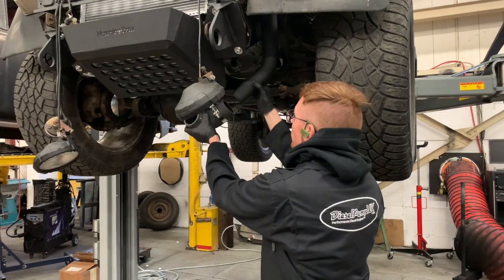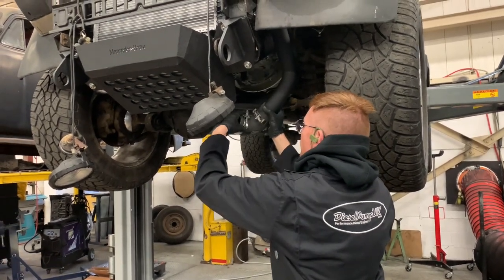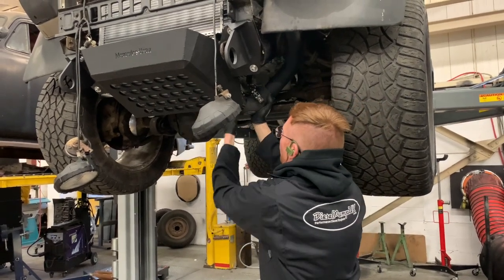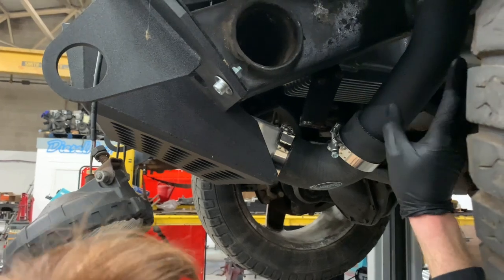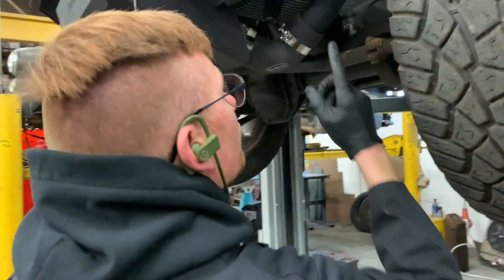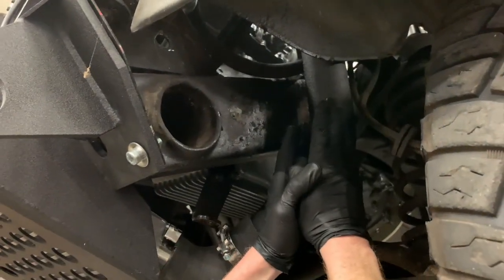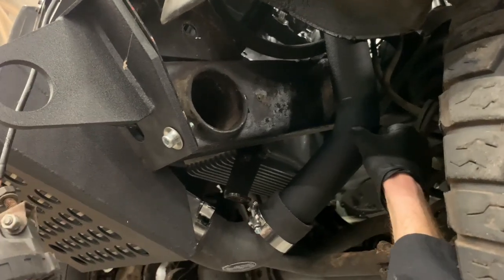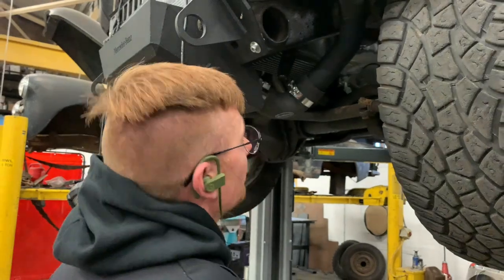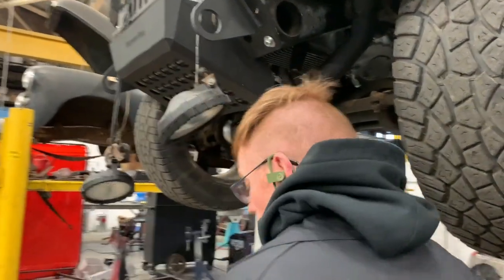And that just literally is as simple as pushing that onto there, and then if the clamp will allow me, push that onto there. We push that on there and that's it. What I normally do, if you are building a right-hand drive one, is this inner wing is normally a little bit tighter to the chassis rail, and I just prise it out a little bit. It's usually about an inch closer in, and it's just a case of getting a piece of wood and prising it out so that it doesn't rub on your boost hose.